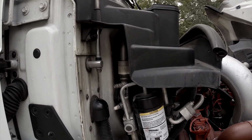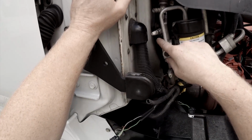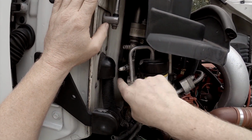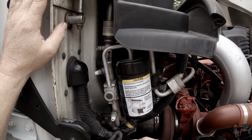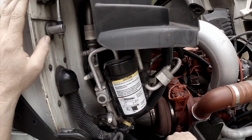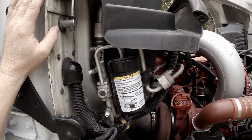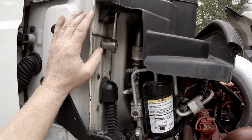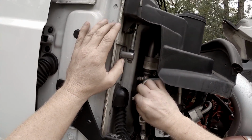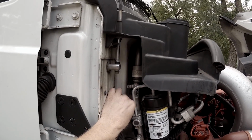This time though, I cut the wires so that I could actually test the thermistors, get readings off of them, because where this one is, you can't get your test pins in there. Now my thermistors are reading 2.5, I think it's K ohms, something like that. But I'm not sure, I didn't check to see where my settings were. Anyway, this one is reading way off. It's a whole 1,000 or so off. So this thermistor up here is bad again.